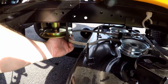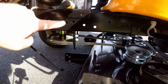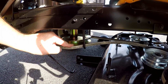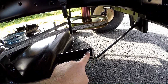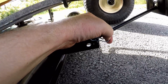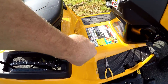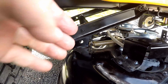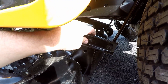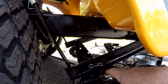Take the belt, slide it through the belt guide, and back onto the pulley. Push on the belt guide to get it back through the hole. Don't forget to put the belt guide back in place or the belt can slip off and break. Put the front rod back into the hole marked 42 and install the clip. Go back up on top of the fender on the right-hand side and lower the mower deck all the way down. Install the lift links on each side — make sure you don't forget the left side. Install the clip on the left hanger, then put the clip back on the lift frame on the right-hand side.